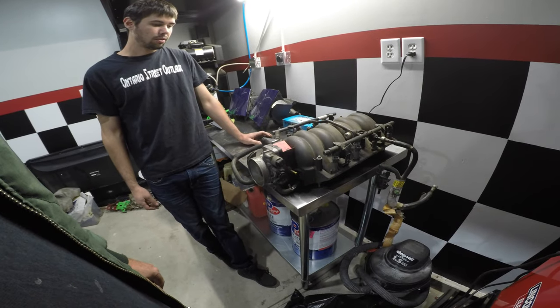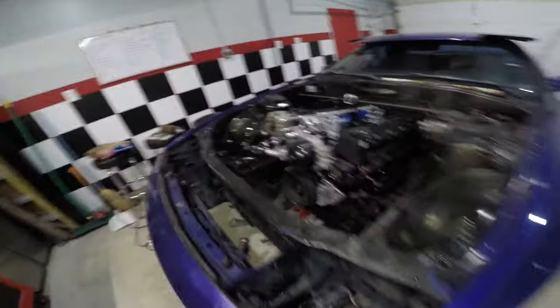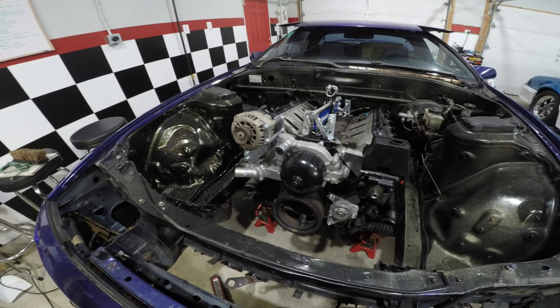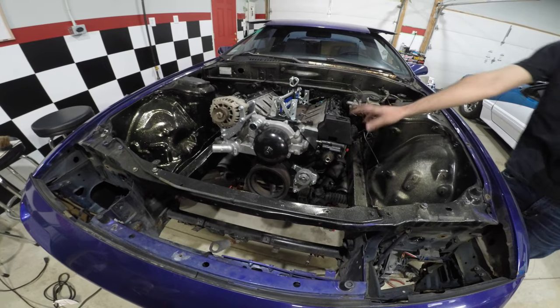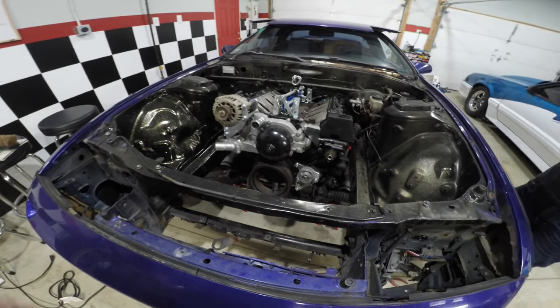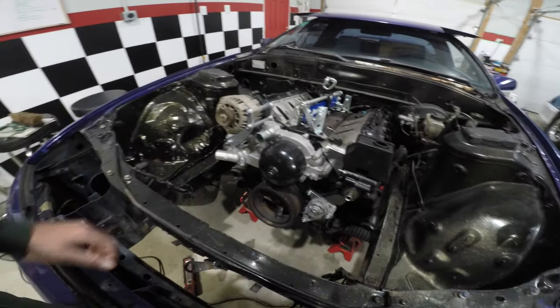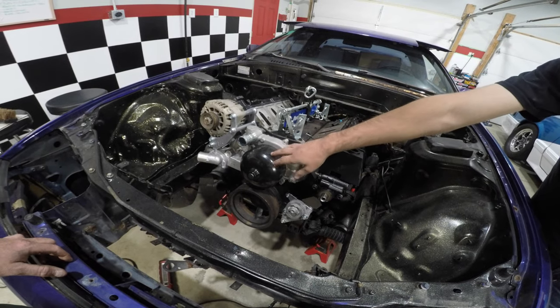These are off of a 2001 to 2003 Firebird and Camaro. It's got the throttle, it's got the linkage — see, it's all cable-run over here. He's got the aluminum brackets on it, it's almost ready to fire up. Got a nearly new power steering pump. That's off of a Firebird. He's also got the LS1 water pump off a Firebird, which he's gonna have to space out — need to put a spacer behind the water pump to set it out.